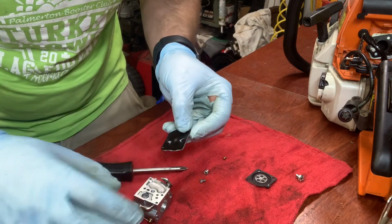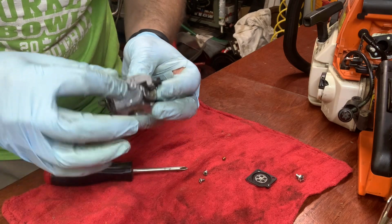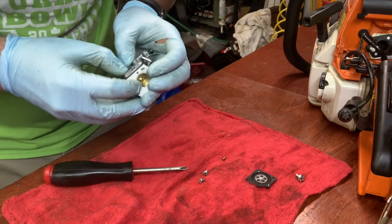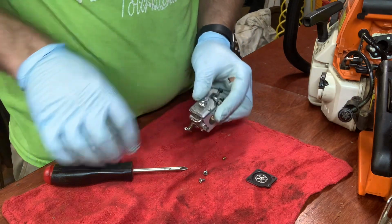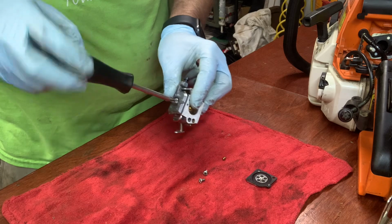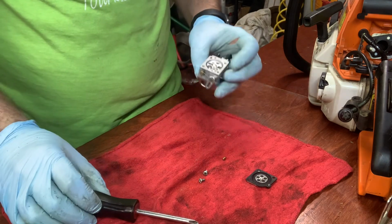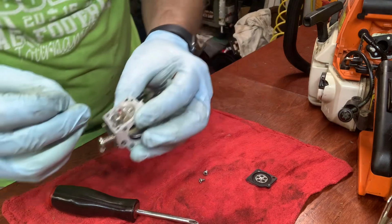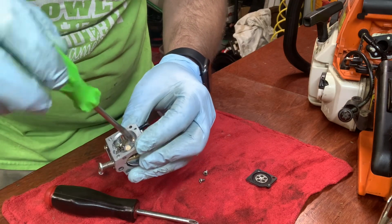Well, the filter was absolutely covered. Was it? Yeah, because it was raining on us. Chips were muddy, and when I took it off, it actually was covered. The other possibility, we'll try it. If it doesn't start, I want to see what the gas filter looks like. Sometimes that gets clogged. That's not enough gas to get it going.